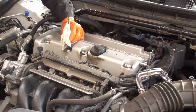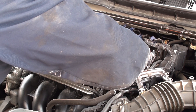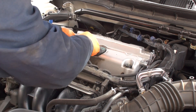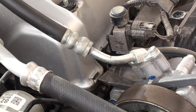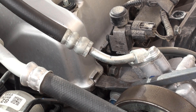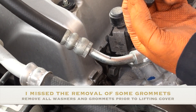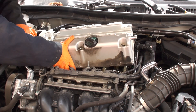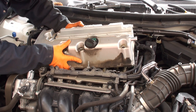Remove the dipstick. Once the cap nuts have been removed, use a flat bladed screwdriver and gently pry at the flat washers and the accompanying rubber sealing grommet on each of the studs. Save these parts for reinstallation later, or if they show signs of wear, find suitable replacements. To make the valve cover removal really easy, go up by the power steering pump and very gently — not on the seam between the cylinder head and the valve cover, but on the tab directly above it — take your pry bar and gently pry up. Pay careful attention as some rubber grommets on the valve cover may also pop off, so get them off in advance if you can. Then lift the valve cover assembly off the motor; it can be quite a snug fit especially around the power steering hose area, so just be patient and work the lid out.